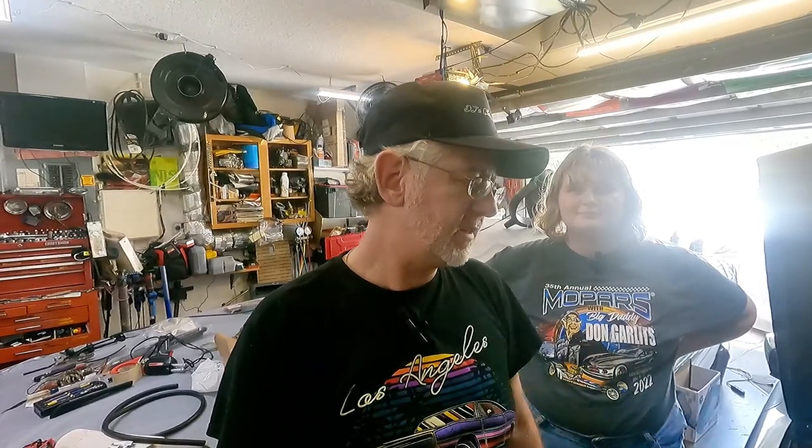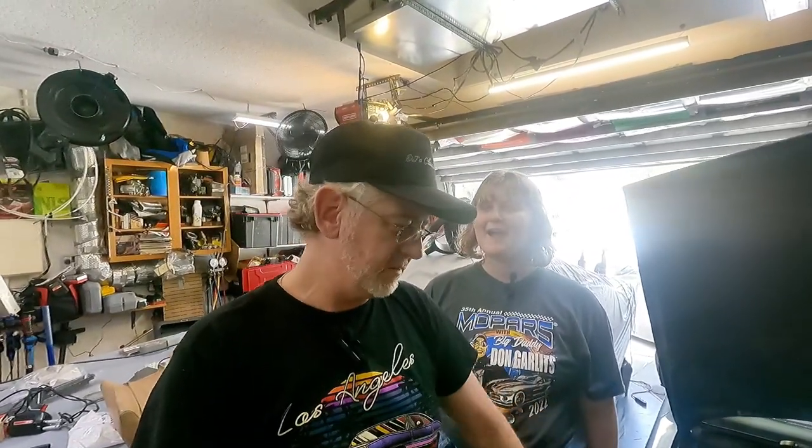All right. Okay, so it's done. It's not very hard, and honestly, if you have a car that has fuel injection, I would highly recommend at least doing a minor rebuild on them if they are still good. Most of the time, they are good. These checked out fine with the ohms. It was like 16 ohms. All of them were the same, though, so I'm not overly concerned. But yeah, my assistant is very helpful with this. She actually was able to do her first fuel injector job, so that's great.